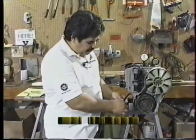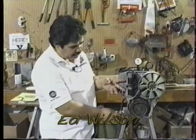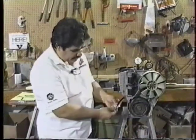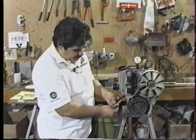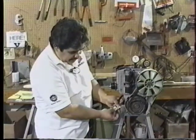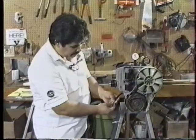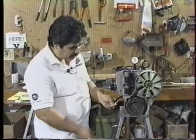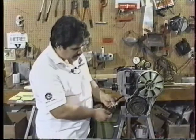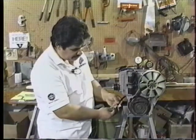What we're going to do today is go through the timing of the Rotax engine. This is a point ignition engine, indicated by the black coils on the front of the engine. These wires coming out of the harness — two of the black wires are for the ignition system, indicating the mag or the PTO cylinder, this being the mag and this being the PTO. You're usually working with a working engine, so by hooking up to these two wires we'll be able to tell which ignition system we're hooked up to. So you'd want to ID the ignition systems first.